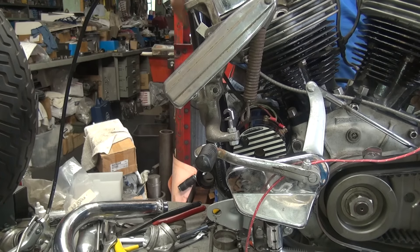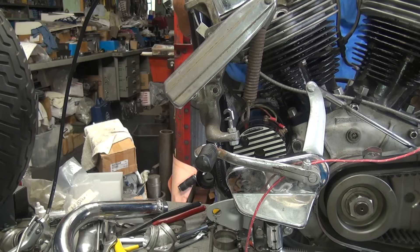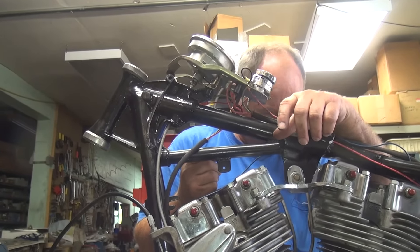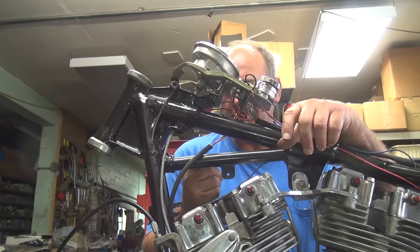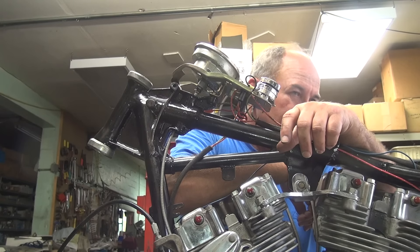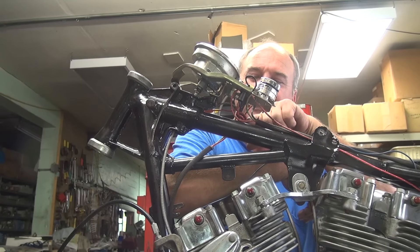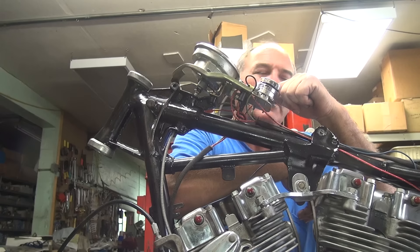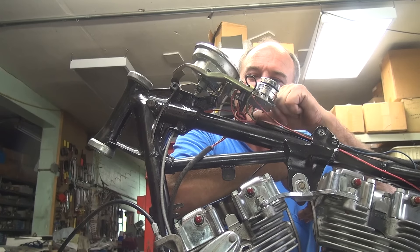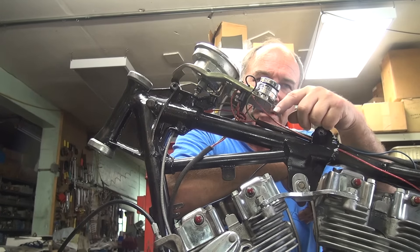The blue wire is your oil. Which bulb is that, left or right? Right now it's left. The center is oil, which I haven't hooked up yet. Why does the oil sending unit send power to the light to tell you you've got low oil pressure? That's the power on the other side of the bulb. We've got to power the other side of the bulb — that's why we have a bulb with a black and a red side. So we need to get the red side hooked into the hot side or ignition side. I'm going to hook the red side of the bulb to the ignition, black to the oil pressure switch, so that if it loses pressure, the light comes on.